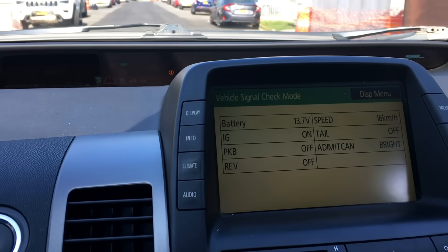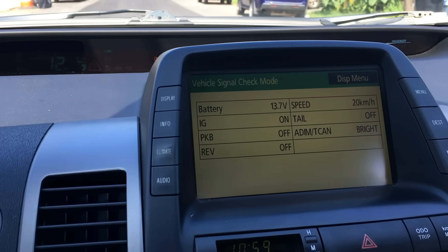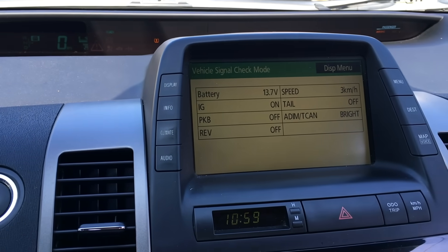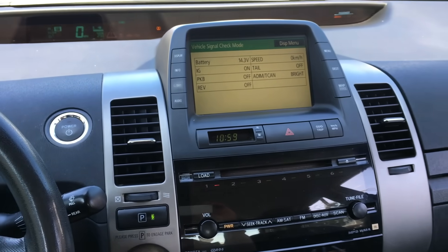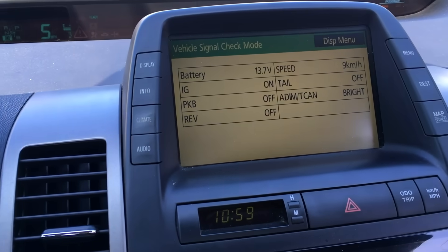Don't be nervous that when you're driving, the voltage will take a little bit of a dip. You could see that I am at 13.7, but that is normal. Basically when you park, the voltage will go up a little bit — that is fine. When parked it's at 14.3. As soon as I engage drive, the voltage will drop a little bit because it is actually using the hybrid battery. That is normal.